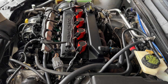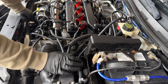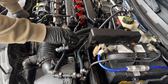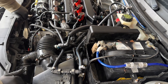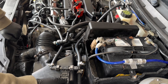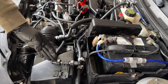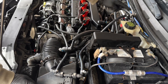Now that there's no fuel pressure, your ethanol kit comes with an additional hose. The eFlex company recommends measuring six inches from your fuel rail and mounting your ethanol sensor there. As you can see I don't have space there, so I measured a bit more and mounted my ethanol sensor further along. Basically you've got your fuel rail, the hose connected from one end to the other, and from that end it goes all the way to the sensor.